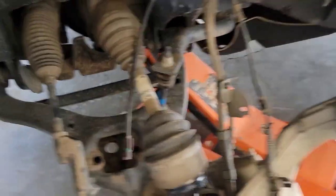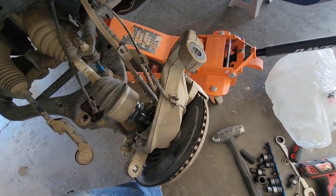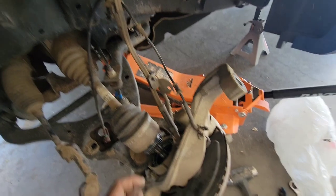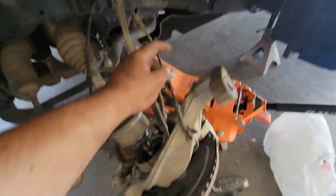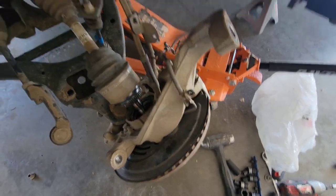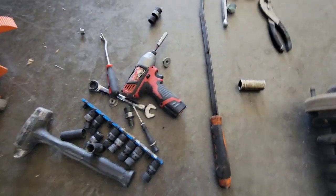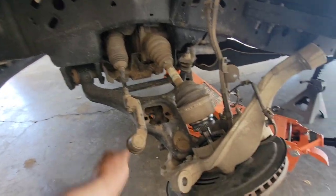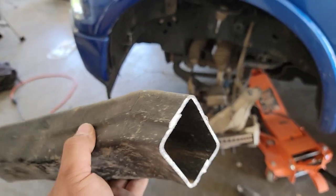Alright guys, so this is where we're at. None of this is really tight. All these lines right here — you just have to unbolt from your knuckle or spindle. Get these little clips off their bolts: 10 millimeter bolts, one 8 millimeter bolt, a bunch of clips. I disconnected the connector from the top and just brought it down because this will get pulled if you don't disconnect it. Obviously get your nut off the axle shaft, and it should just slide out. Get this off as well — 13/16 socket.